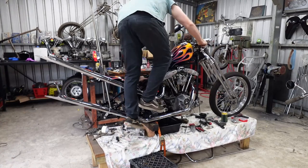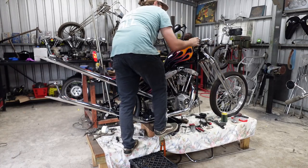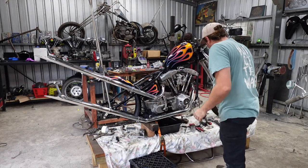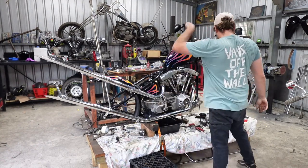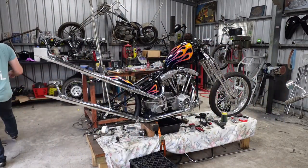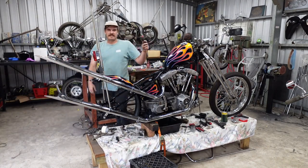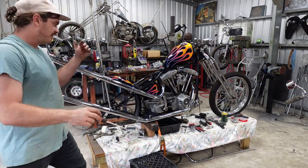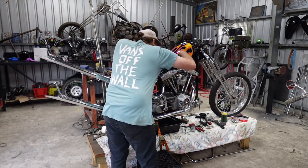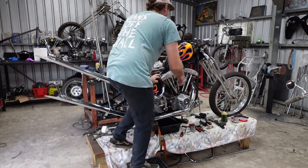And then the ignition. Oh, once, dude. It's easy when I don't have a handlebar to squirt fuel into it, so I'm gonna pop the idle. I have one screwdriver, I'm just gonna up the idle so that it's got a bit of air to get it going, and then I'll turn it back down again. So it should start pretty high here, so I'll turn it down when it gets going.